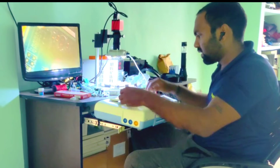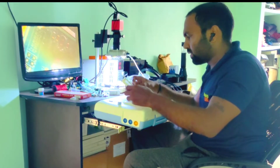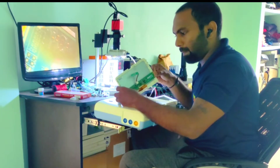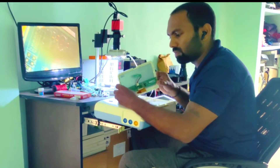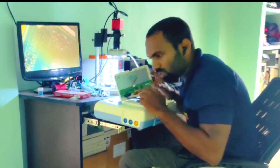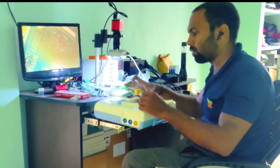That is simple. If you hear the beep sound when you touch any functions, the indication is coming and the sound is also coming — which means the mainboard is not the issue. So we should check the LCD driver board.